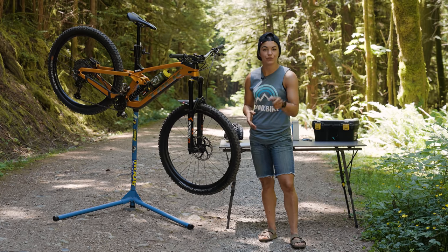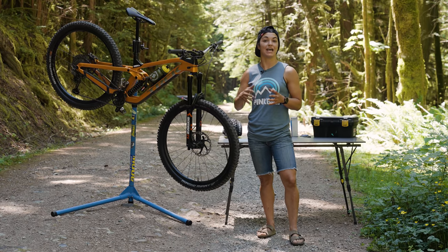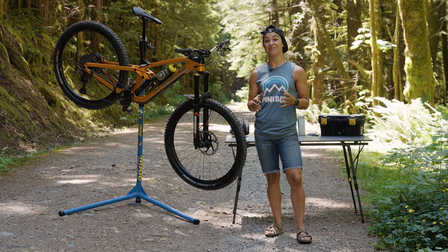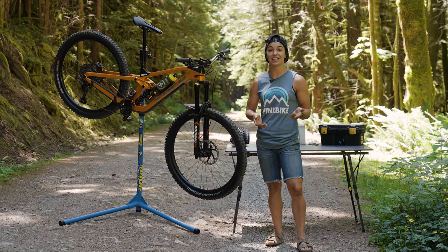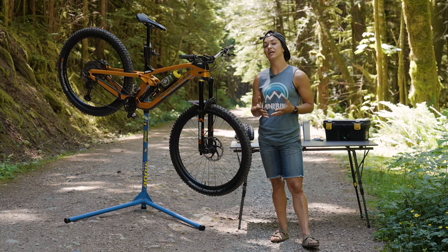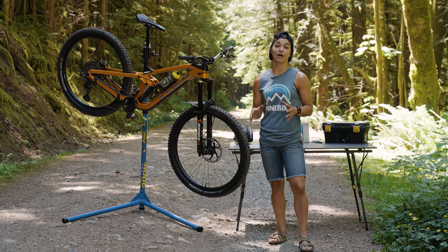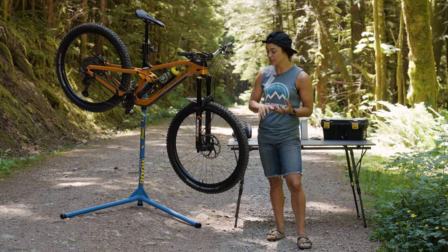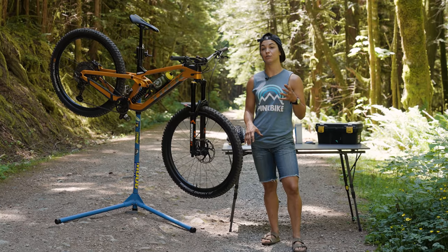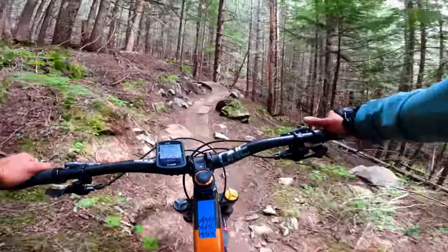A bonus topic worth considering is your tire casing. I always go for a mid-to-heavier casing because I hate flat tires - touch wood, haven't had one in quite some time. On race day you're often a bit fatigued, not taking the smoothest lines, and riding harder than usual, so it might be a good idea to go up in casing to cover yourself. Do bear in mind though - if you're used to thin cross-country tires and you slap on a big downhill casing, it'll feel heavier and slower rolling, so maybe practice with it a couple of days before your race.